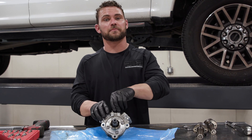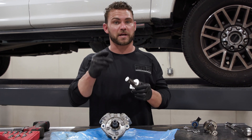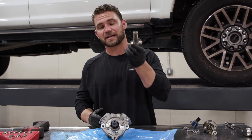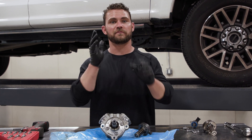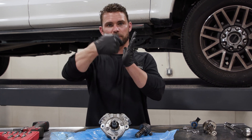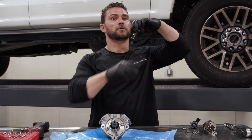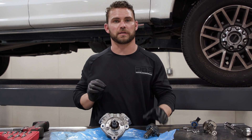Let's get this Volume Control Valve out and talk about the piston. You can see there's a spring here — as you notice when I removed it from the bore, it popped out because it's under spring pressure, hence the high pressure fuel. What actually presses on this? Think of a V2 engine — that's exactly what this is. There's a cam in the middle; as the cam turns, there are lifters that go up, and when they go up they hit this spring, which creates high pressure fuel. This pump works just like an engine.